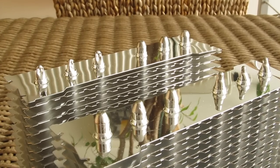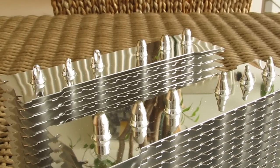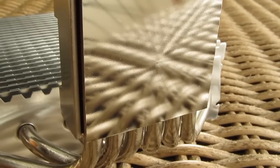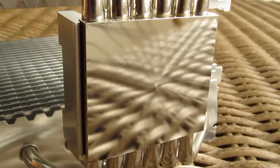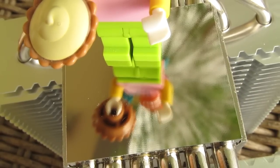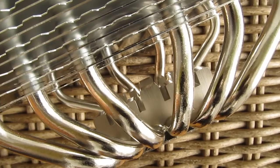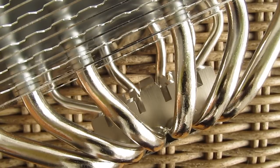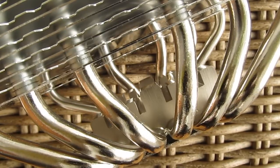Running through them from the very shiny top of the cooler to the bottom, we have six nickel-plated copper heat pipes which meet on the bottom in a also nickel-plated copper CPU base. It's almost polished to perfection — you can basically see your reflection in it. On top you can see a heatsink-like structure that also serves as a pin-down point for the crossbar for socket installation.